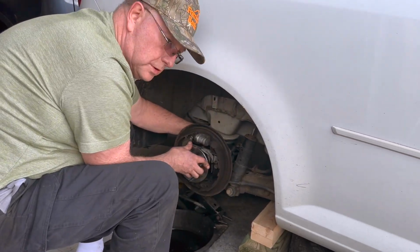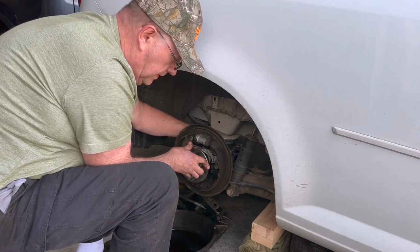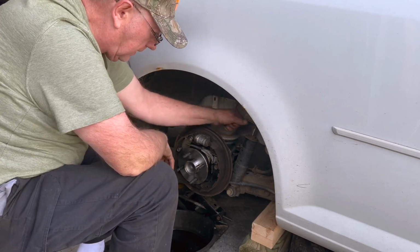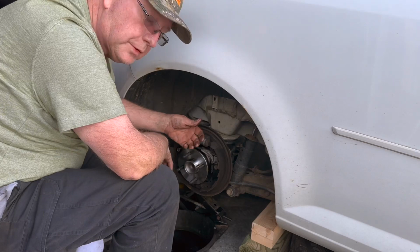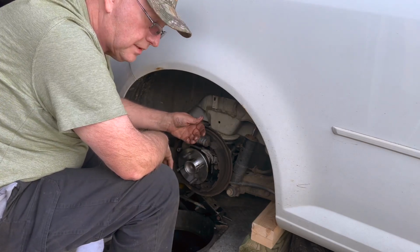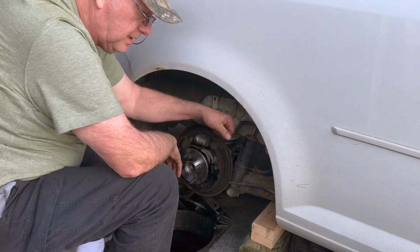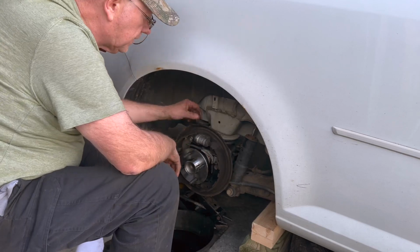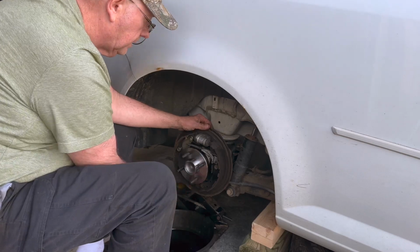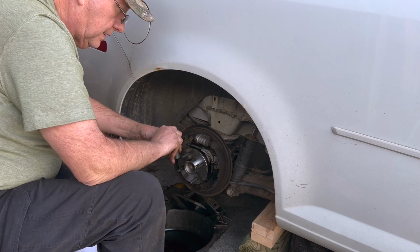Now I took the bottom ones off with a 15 millimeter wrench. Just takes you a little bit of time. You've got enough room to get into the top down there to break them loose, because the torque on them, I think is, don't hold me to it, you might want to check the specification, but I think it's like 35 foot-pounds, and once you come to that, then it's another 30 degrees. Then your wheel nuts, they torque at 100 pounds. And so you want to get that on there and get that going good.